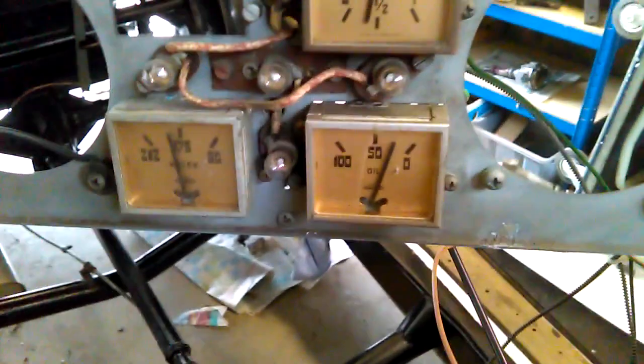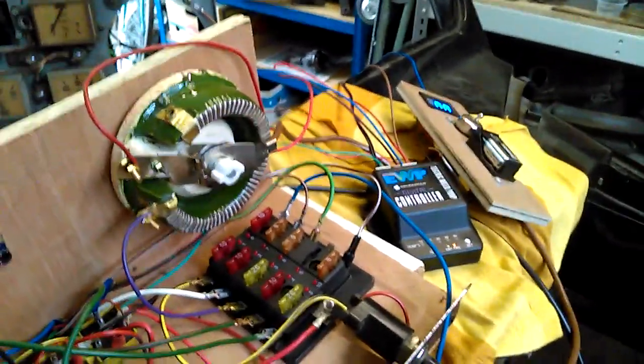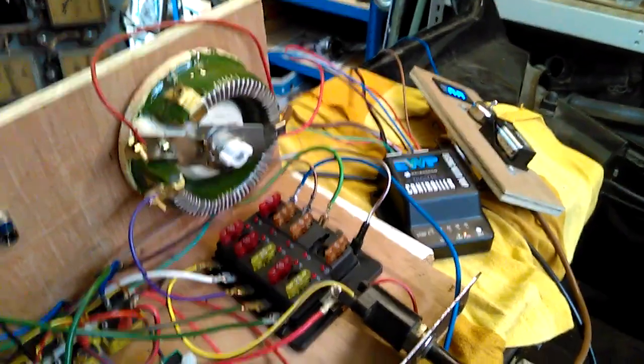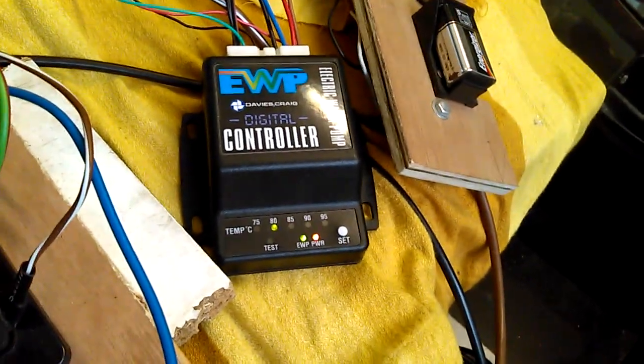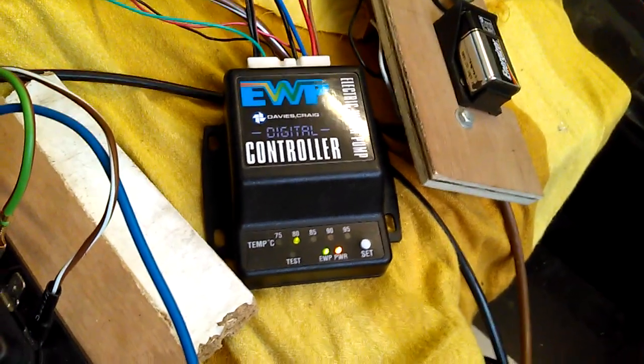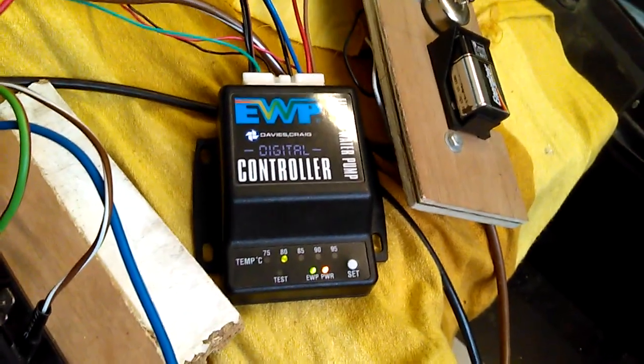We're on about 1 on the temperature gauge of the 175 there. So that gives me a nice predictable setup for how the cooling system is going to run as I go forward in my next step in setting up the carbs. And we can see that the pump is still running because the temperature switch is above, but as it cools down, then that will switch off.